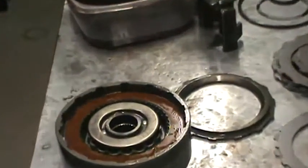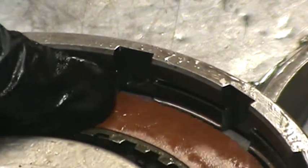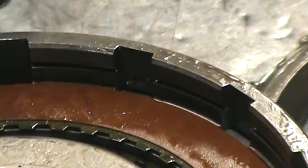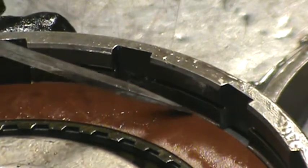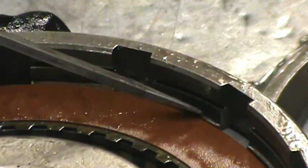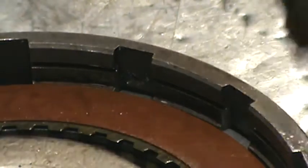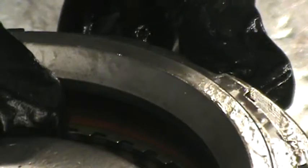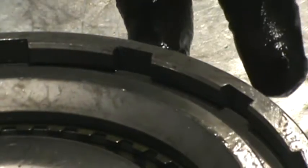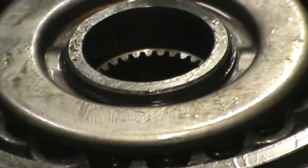Let's zoom in and I'm going to show you what we're going to look for here. Right here, you're looking for how this disc sits to the edge. I can feel with the little screwdriver it's sitting just above it. So we're going to be tight. Another thing you can check when you drop it on is I can hear it hit the disc instead of hitting the drum metal to metal.